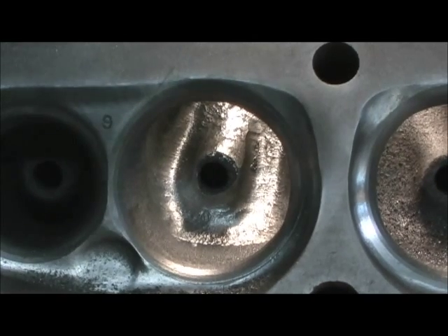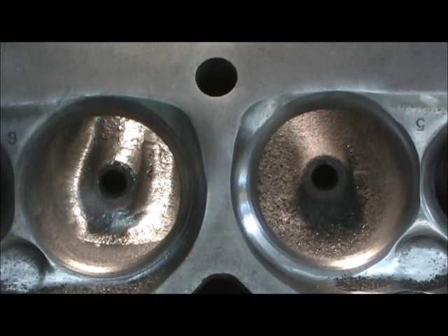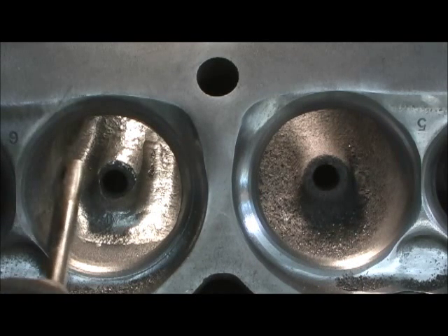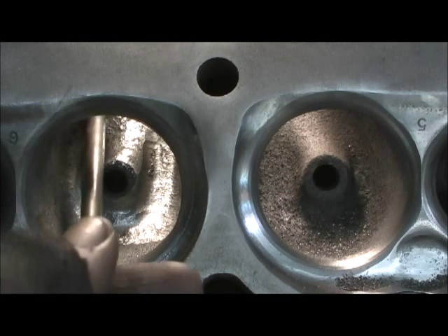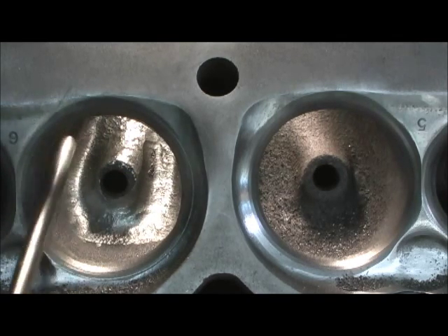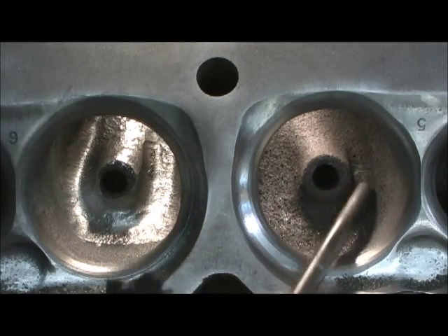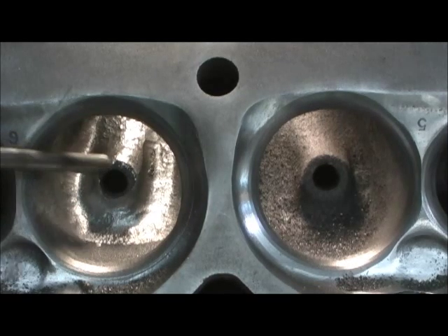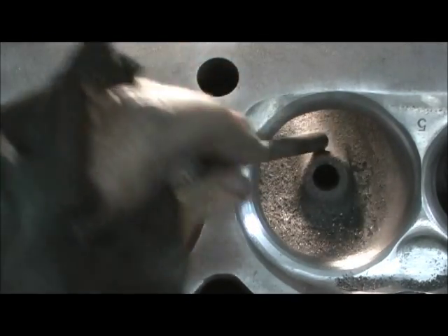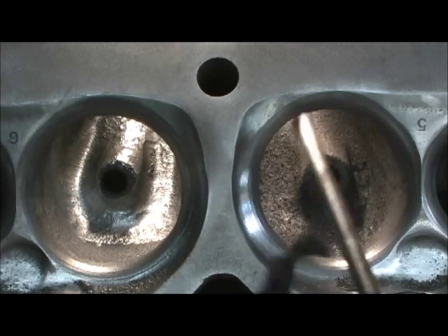Now if you take a look — look how much more area. If you look at this one untouched, I can barely fit this shaft through there. Look how much wiggle room I've got here — moving that over about 100, maybe 120 thousandths. Here I've thinned the guide out and moved the walls over, mainly this wall. Compared to this really rounded piece right here — when the air is trying to come through, it's actually gliding over the top of it, not getting down around it. This is going to increase your high-lift flow areas — lifts above 300, at lifts 3, 4, and 5 — as it tries to find the path of least resistance and go out into the chamber without the chamber wall being shrouded.